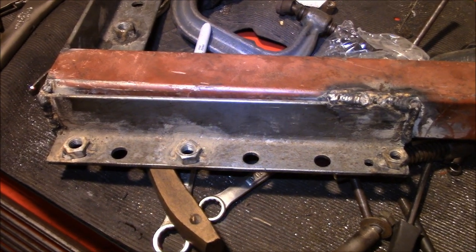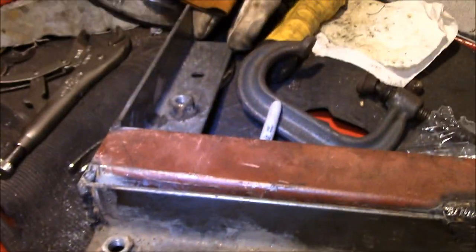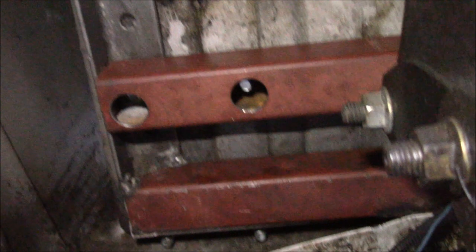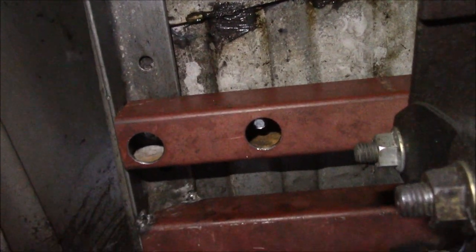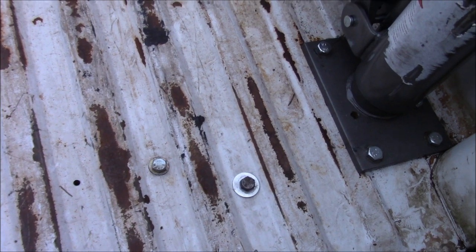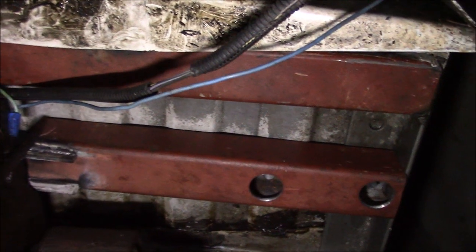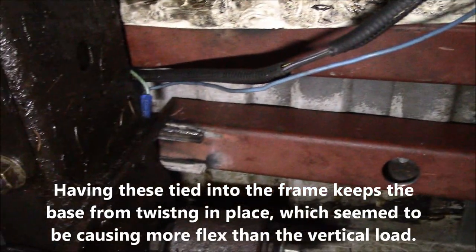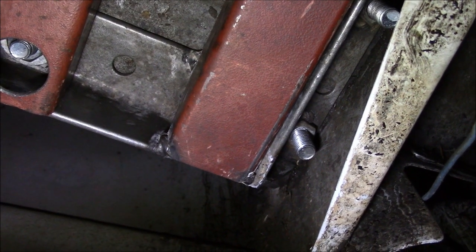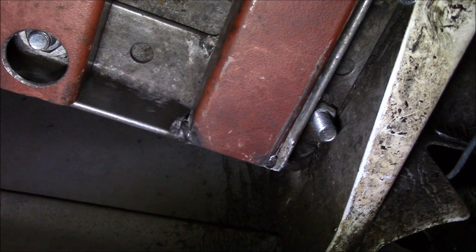We were tired of having to keep trying to put those nuts on there so we just tacked them in place — real easy to bolt it in from the top side now. In the end we used that right angle piece of framework. We've got the angle iron and a couple of cross braces that run over to the frame. Ideally you kind of want to run that beam all the way over to the other side of the frame to really give it some strength, but having just a couple of these supports running over to the top of the frame actually beefed it up quite a bit. If you don't have a very structurally solid bed to begin with, you're definitely going to have to keep this frame beefy under here to handle the weight of the crane.